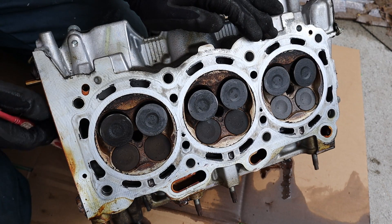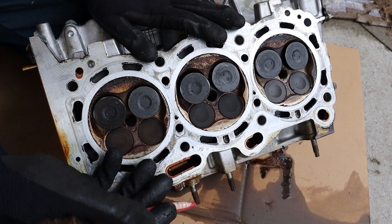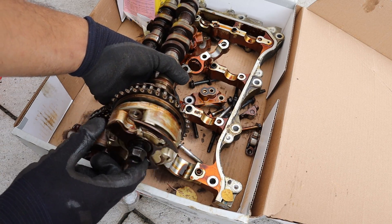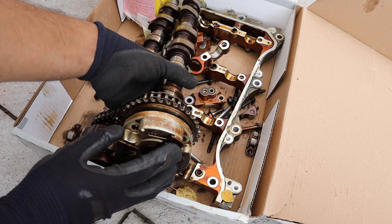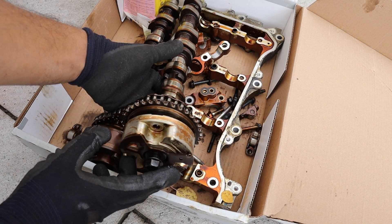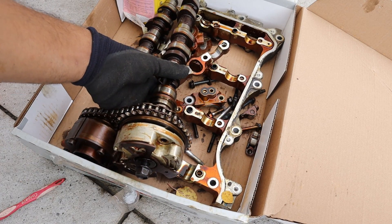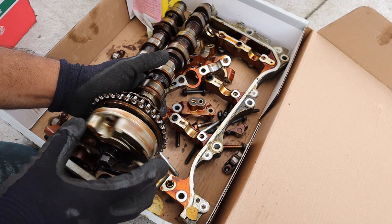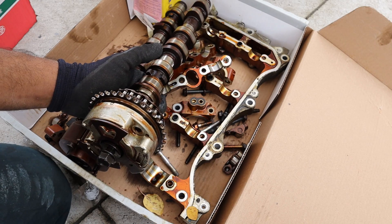This was the rear head, so I still had to pull the motor just to get it off — you can't even get the catalytic converter off without pulling the motor. I did a little research and found there was actually a technical service bulletin and a safety recall for these bolts backing off, because when they do back off it's obviously going to cause the engine to stall. But those only cover the Lexus IS and Lexus GS models, not the ES or Camry or any other front-wheel drive model. This is an early build 2GR, so maybe someone forgot to put Loctite on there. It's pretty catastrophic what can happen when just three bolts back off — you can blow the whole entire motor.